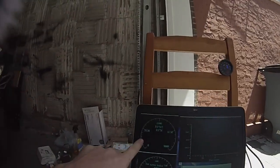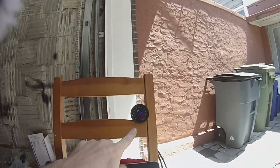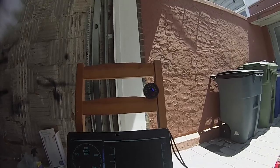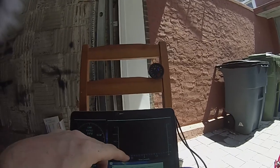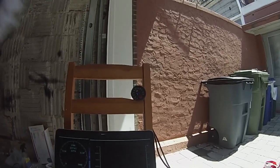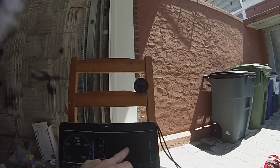So we have the bike running right now. Hopefully you guys can see we're picking up the RPMs on the engine and we got our air fuel ratio adjusted. You always want to shoot for around 12 to 1 for max power and then tune off the horsepower from there. So we're going to try to get quarter throttle to 12 to 1, half throttle to 12 to 1, and full throttle to 12 to 1, and we'll make fine-tune adjustments looking at the horsepower curves.